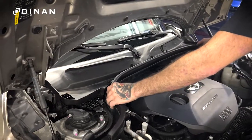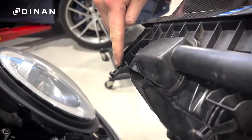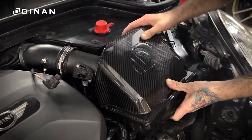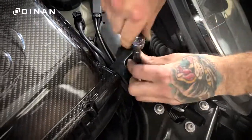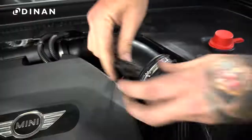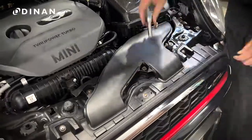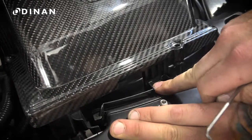Reinstall the rubber seal. Next, put the airbox back into place using the two mounting locations on the bottom. Gently press down and then tighten the one 10mm screw between the airbox and the headlight. Reconnect the turbo inlet pipe by tightening the hose clamp and reconnecting the MAF. Put the intake inlet pipe back into place and tighten the two 10mm screws. Once you clip the intake inlet back into the airbox, you're all finished. Thanks for watching.